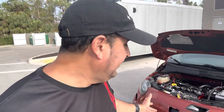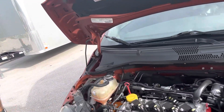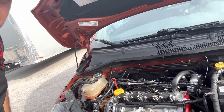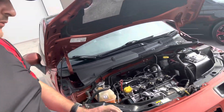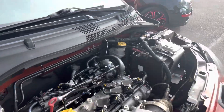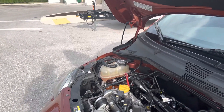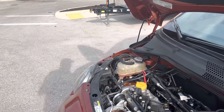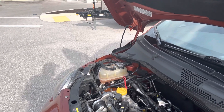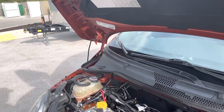Here's the big reason why we're all here — this is the first T-jet converted 500T in America. As you can see, we don't have a vacuum pump on the back side of the engine. It's still got one cam gear. Generally the whole bottom end of the vehicle is the same: same forged pistons, same forged crank. Everything on the bottom is pretty much Fiat 500T, Abarth — all of it's the same, same 1.4 liter, same transmission, same everything.